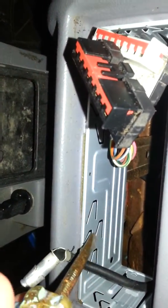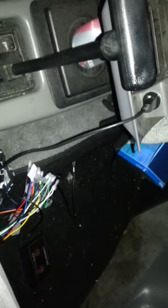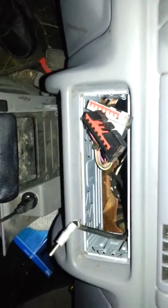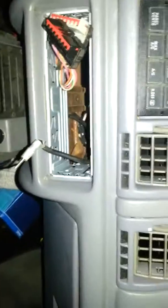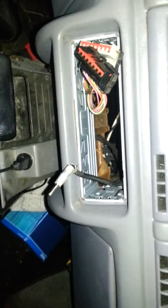So I brought a screwdriver to try and use on those, but now I'm not really sure which ones to lock down or how that's going to hold in there. So I'm going to have to kind of look over this a bit, and I need to take my wires back in there and get them actually bundled up now that I have an idea of what's going on. And then the next order of business is I'm going to be looking at stuff in here to try and get an idea of what I can do for ground connections. And we're just going to have to play by ear with this crappy tray setup and hope I can ground it out somehow, because if I don't, I'm going to fry the radio.